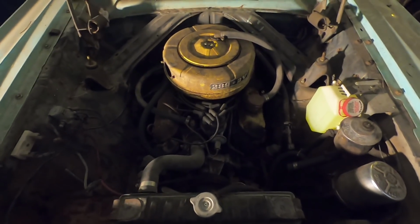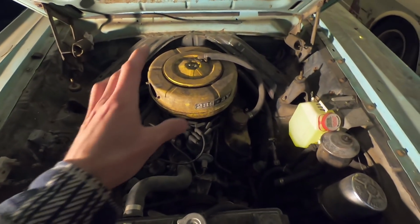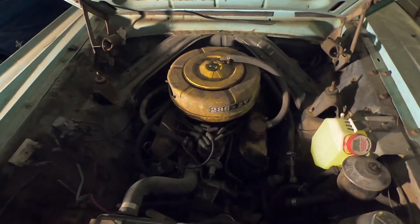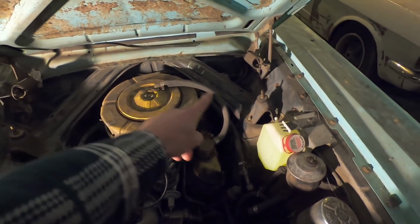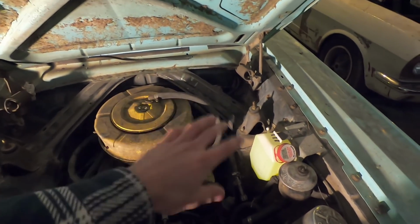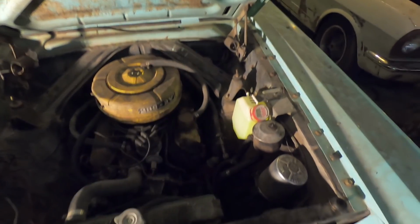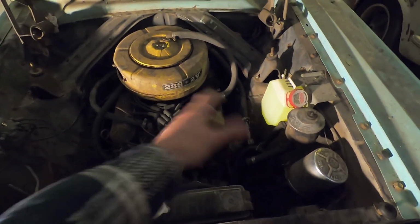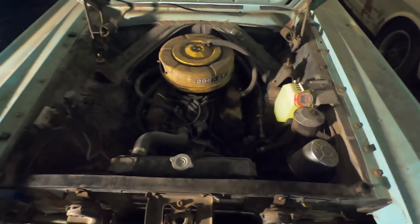This car also needs head gaskets. So we're going to take the heads off, put brand new head gaskets on, and we're also going to go ahead and put a 4-barrel on while we're here. It is a 2-barrel car. Lastly, it's got a single reservoir master cylinder. I noticed there's not a lot of room underneath that brace. So I don't think I'll be running power brakes. So I'm going to run a dual reservoir manual master cylinder there. It is a power steering car, but something happened with the power steering slave. So that's about it up front.